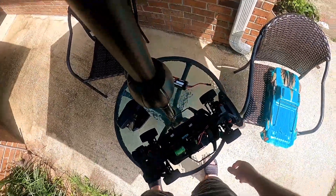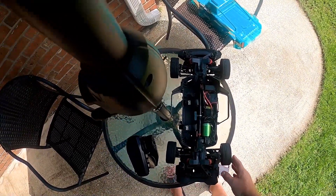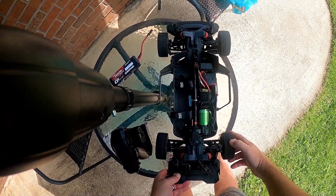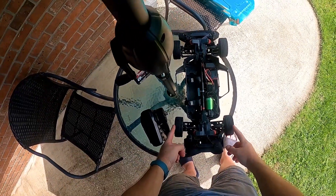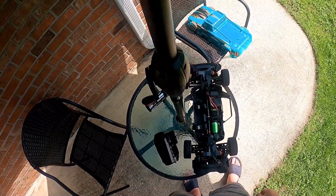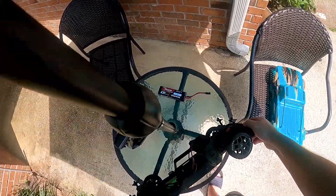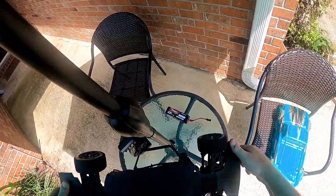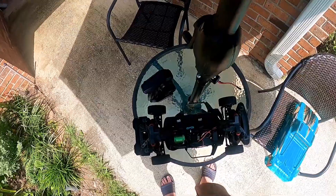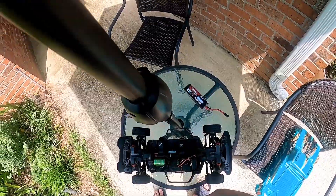Look at this back tire — look at how tilted in it is. I wonder if there's an adjustment for that, but actually I don't think there is — I think it's built into the swing arm. Both rear tires really have a lot of toe-in, which is weird. In the front you can't adjust it either; there's no adjustment on those arms. I'm going to have to look at getting a fan, then put the bigger pinion gear in and see how fast it goes, and also try to fix this servo issue.